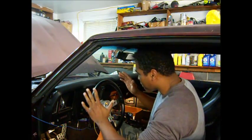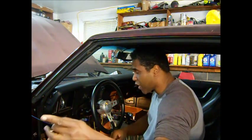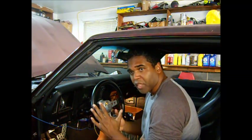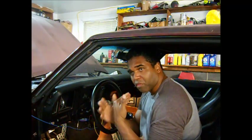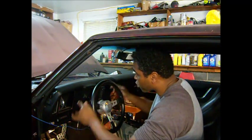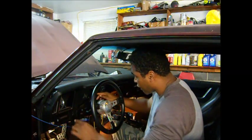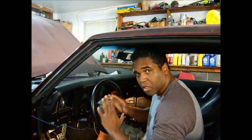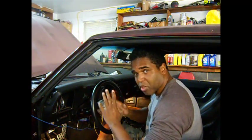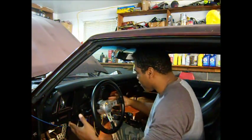This particular car has a dashboard that's different than the Chevelle — it doesn't have a circuit board in the back. So there's not a 12-volt circuit with power going through all the gauges at once from one circuit board. The 12-volt goes through each and every light and gauge separately, with wires that are spliced and daisy-chained going to certain lights and everything.